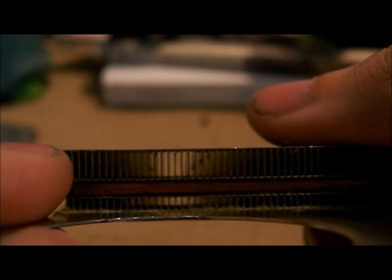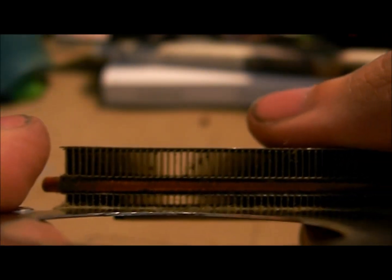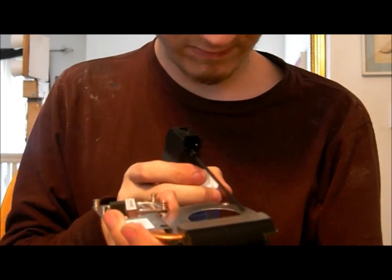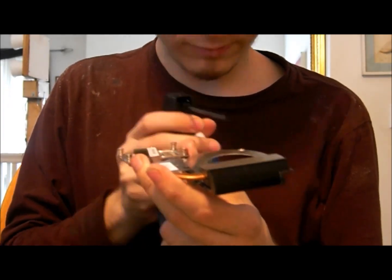While I was waiting for my fan mail, I decided to give the cooling system a good clean. I got a can of compressed air from Walmart and sprayed the crap out of that heatsink until it was as clean as I could possibly make it. I also sprayed the keyboard a bit too. After about a week of my laptop sitting on the dining room table in pieces, the new fan finally arrived.